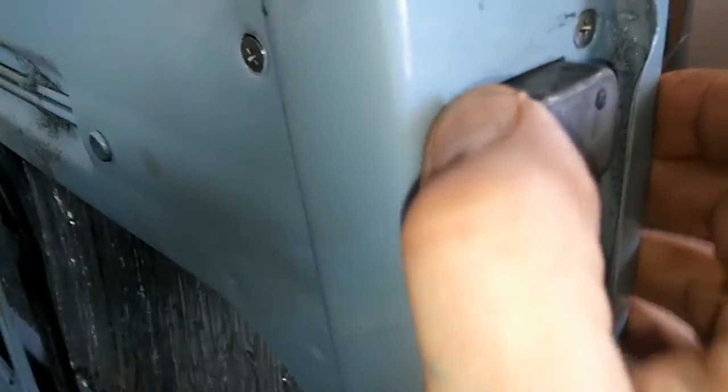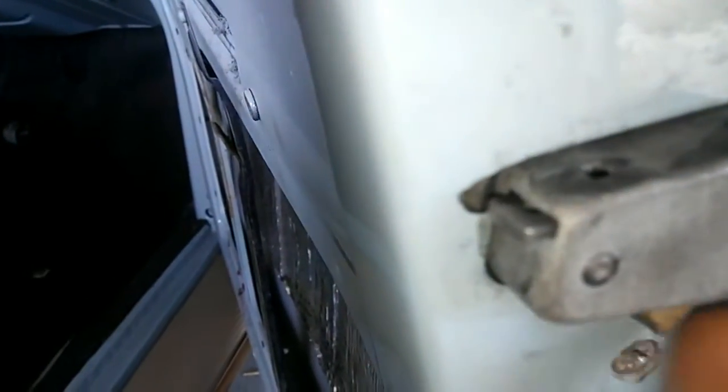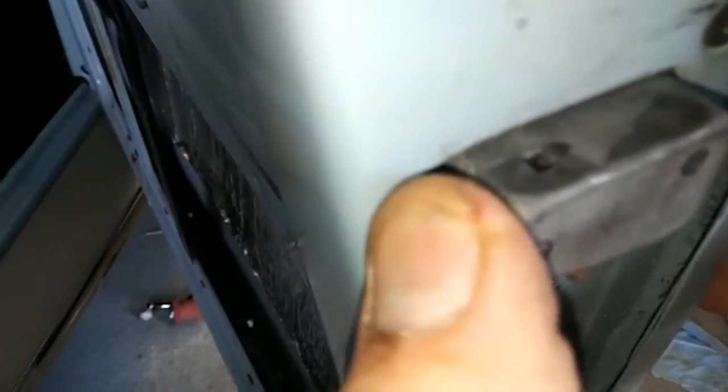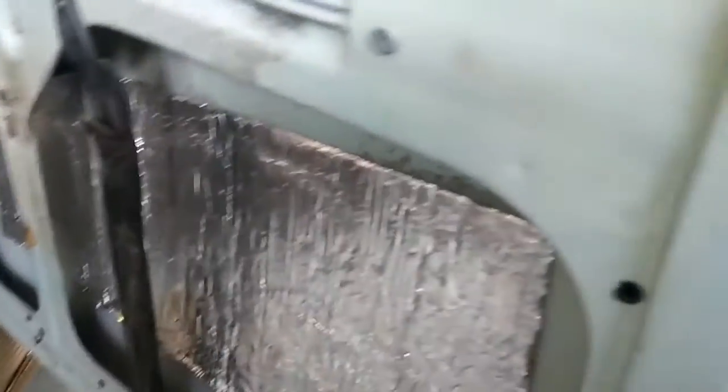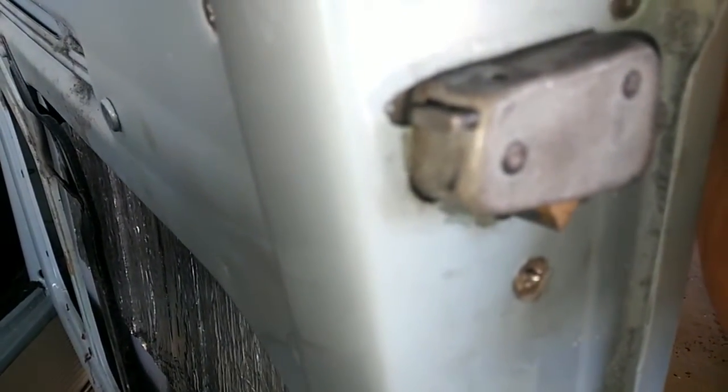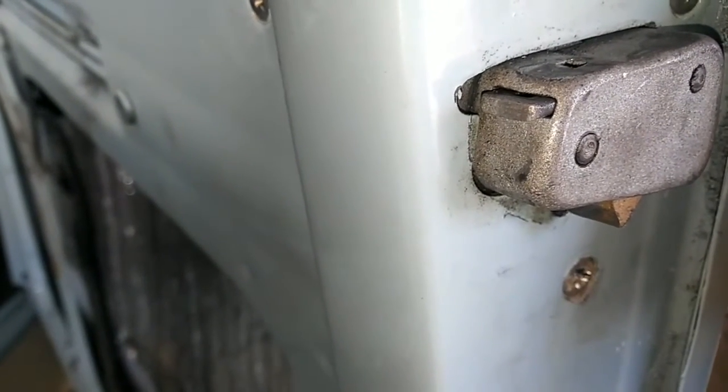Don't be surprised if you have to do that if you ever have to change that door latch - these door latches are really tricky. When it goes all the way shut, this thing's pushed in and what it does is it locks this thing from going up. The spring on it stops it and it goes up. If it's working right, you should be able to push it in and see a little thing popping up. If there's nothing popping up, you probably have a problem with your latch - and that's what's wrong with mine. I've got to replace it.